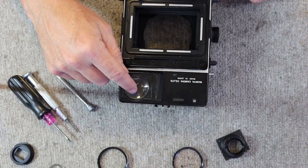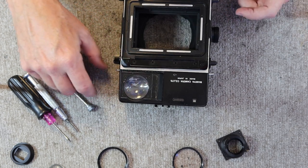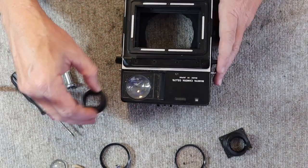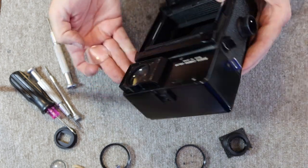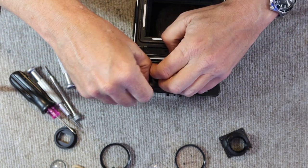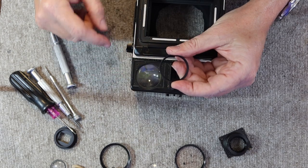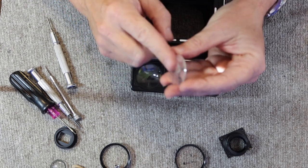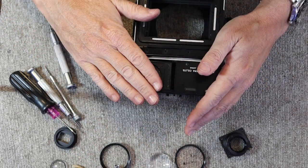And then here we have a couple of lenses in the back. You see some bits of glass around here. That's normal. It always comes off because this is a really snug fit when they put in the lens holder here. Go ahead and just drop that out and let the first one fall out. Then there's a spacer here underneath. The wide end of the spacer faces rearward. The narrow end of the spacer faces toward the inside of the camera. And the lenses, the curved, convex part, faces toward the front of the camera, and the flat faces toward the rear.